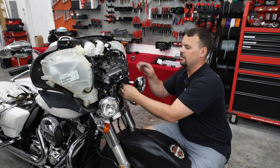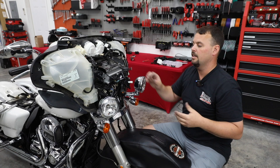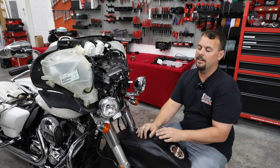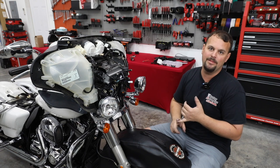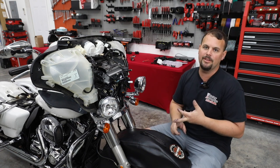A couple things I don't install. This is my personal bike, so there are some things that I just am not going to use. I did not hook up an FM antenna. We're not gonna do FM. If I do later decide to, I'll run a new antenna all the way to the back and put a mast. I think a hidden antenna is a waste of time. LED lighting is gonna block FM reception. Class D amps block FM reception.